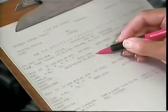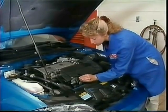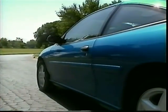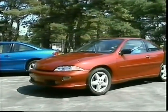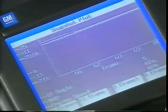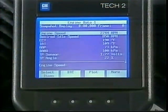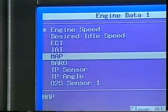Here's a known good vehicle road test example where the customer states there's hesitation on acceleration. The system check and visual inspection identify nothing, but you suspect the MAP sensor, throttle position sensor, or crank position sensor based on previous experience. A vehicle road test with the Tech 2 to recreate the condition is a good idea. With the Tech 2 set up for manual trigger center point, a snapshot is taken when the hesitation is noticed. The second snapshot records engine parameters on a known good vehicle under the same speed and road conditions. In the first snapshot, TP and engine speed seem to increase smoothly, but the MAP shows a fluctuation. Comparing that to snapshot two on the known good vehicle, all three sensor signals increase smoothly. While in snapshot, you have the option to plot data on a graph — select Plot, then select the items to be plotted, and press Exit to continue plotting.